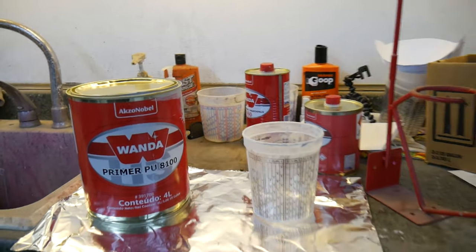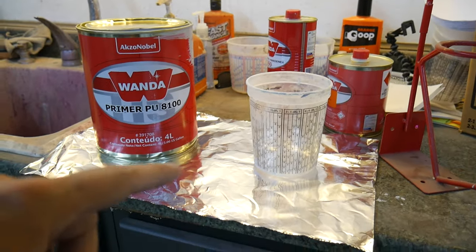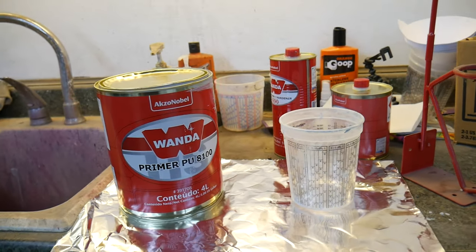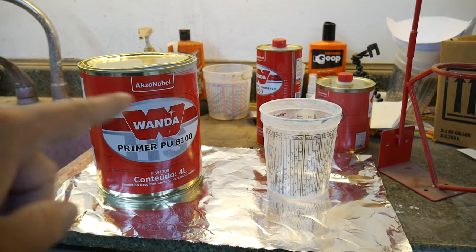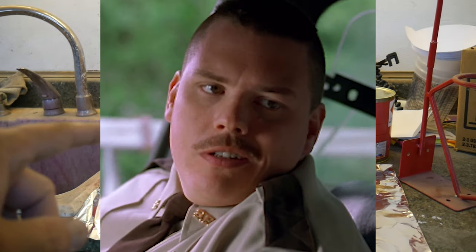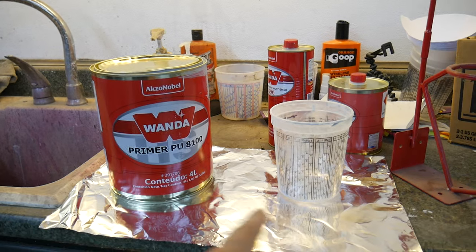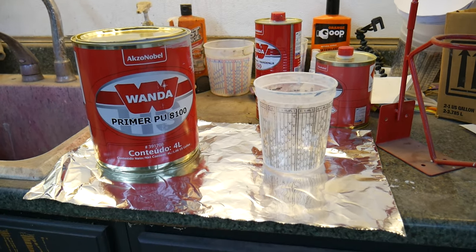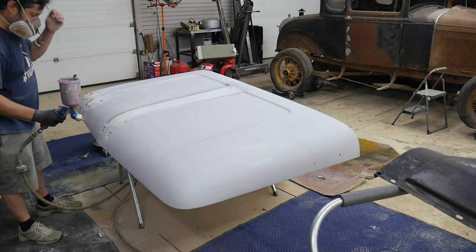Pardon the mess here, but when it comes to mixing my paint and hardener and reducer, I like to do it on aluminum foil. I don't have a fancy system, you know. It's not like I have a paint booth or anything like that. Just at-home stuff here. No, this is not sponsored by Wanda. I've used that primer in the past. As far as a filler primer, it does really well. But I do it on aluminum foil. Things are going to drip. Things are going to go places. And then once I'm done, just wrap it all up and throw it in the trash.